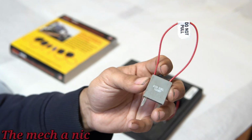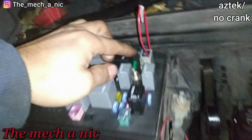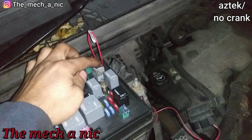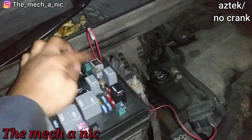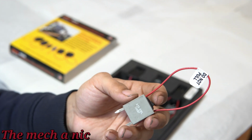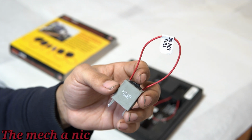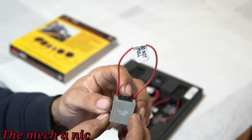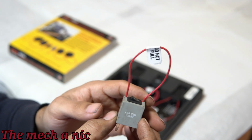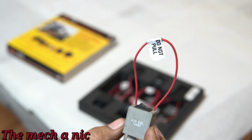So if we turn this switch on and the starter actually starts to crank the engine over, because I put my little jumper relay back in place where the starter belongs, and let's turn the switch on. As you can see, the starter now works. Then we could come to the conclusion, it's not definitive, but it really helps you to go ahead and say, all right, the wiring integrity is good, because when we hit the switch, the starter actually turns on, right?